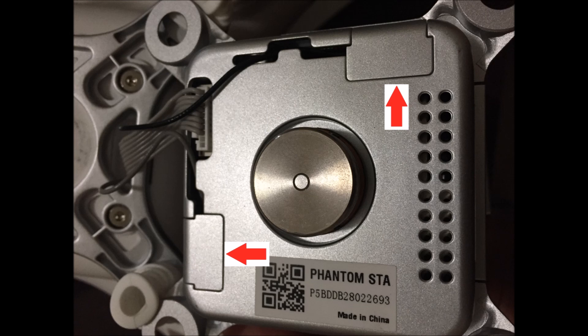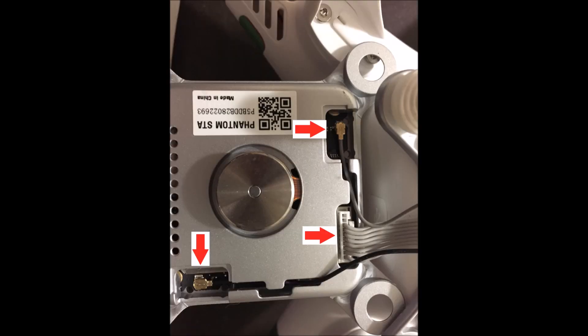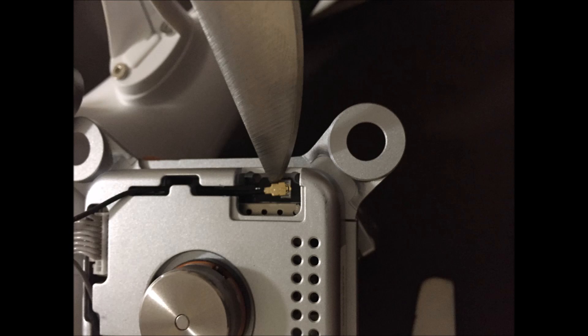In order to remove the other two wires, we're going to have to remove these two plastic covers. This is done by removing two small Phillips head screws on the backside. After you remove these two screws, the covers will pop right off and expose the two connections, which can then be removed gently using the blade of your knife. They'll pop right out and shouldn't give you too much trouble — just make sure that you don't nick any of the wiring.